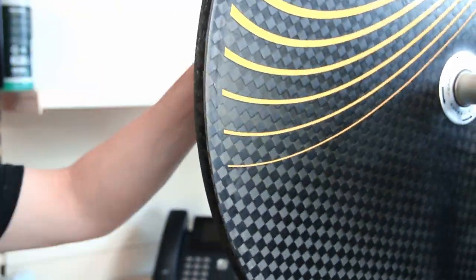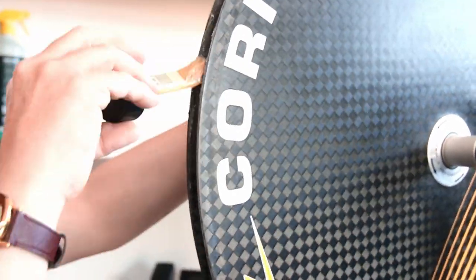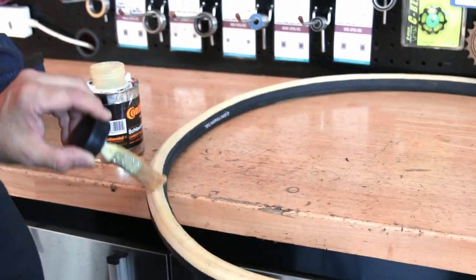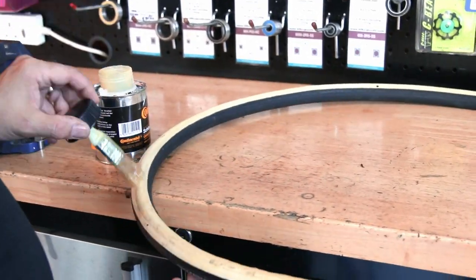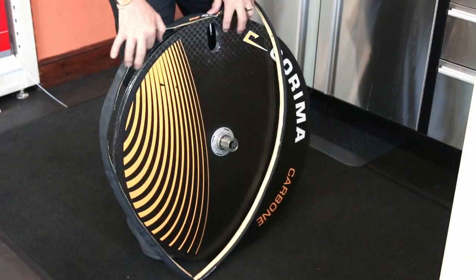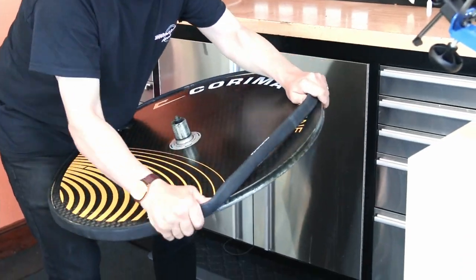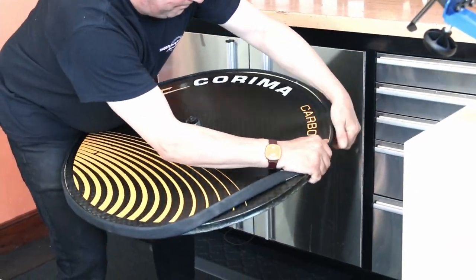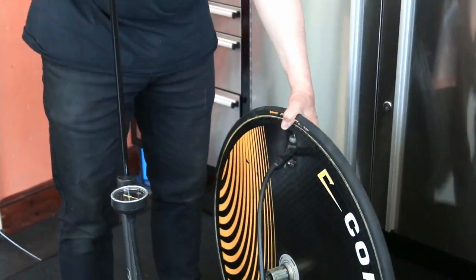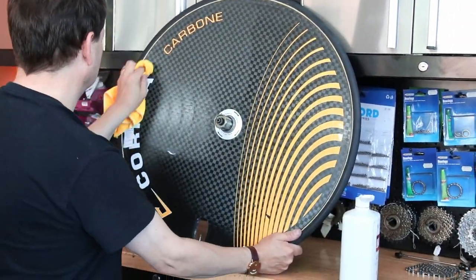So we give this a first coat of glue and that soaks into the canvas on the back of the tyre. Once that's dry, we give the rim a second coat of glue — we already cleaned all the old glue off this rim, which is a very time consuming process. Now we give it a second coat; you want this all clean when you put it back together. We work around the valve — it takes a little bit of practice to get this technique drilled down — but that tyre is now on. We inflate it and leave it overnight to really bond before we give the bike back to the customer.